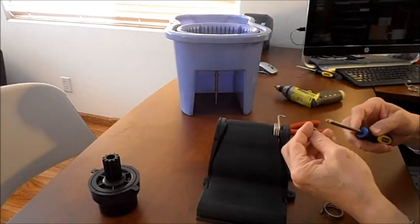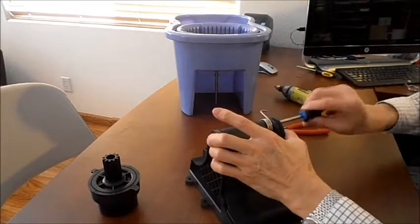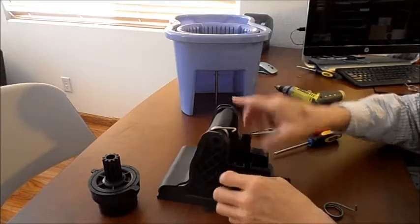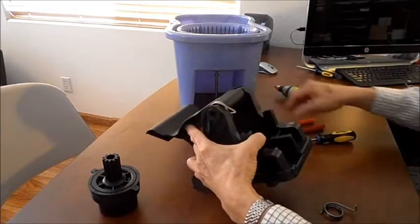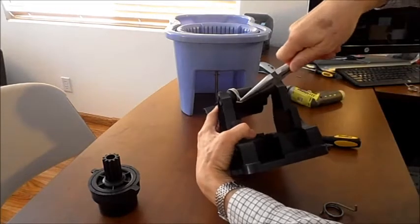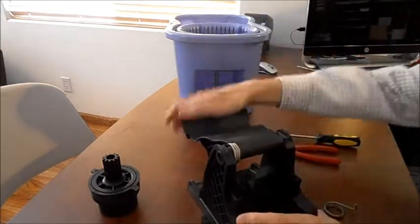This is not absolutely necessary, but for safety's sake — this goes into the spring end, where the female goes — you'll be able to tell from this. Just tighten it. Now all you have to do is lift up the pedal as far as it'll go. Take the pliers. Make sure at this point you keep your hand clear from the area — in case it springs back you don't want to get hurt. It'll take a little force to push this back into that hole, so just pinch it together. It goes back in that little hole. That's all — the spring is back in operation.